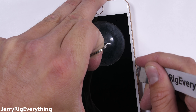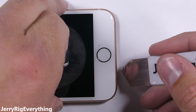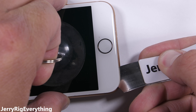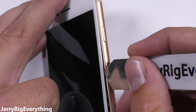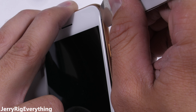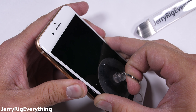The iPhone 8 is IP67 water resistant, just one step behind the LG V30 and the Galaxy S8. That means there's some adhesive holding the screen down to the frame, so I found it easier to slip in just the tip of my tool and slice through that adhesive. It's excruciatingly important to not touch any of the fragile ribbon cables along the right side of the phone — they damage extremely easily. Also, your phone will not be water resistant after this repair, but it's also not water resistant with a cracked screen.